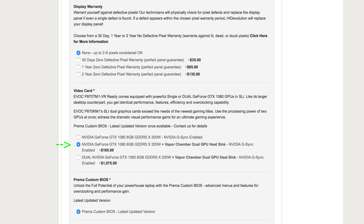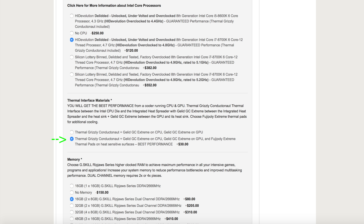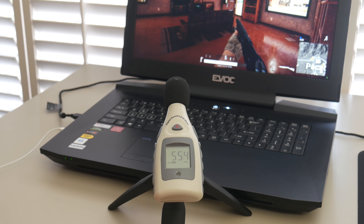Let's take a look at the external temperatures on this laptop. The top section is going to be the hottest at around 47 degrees Celsius. The WASD keys remain pretty cool, coming in at around 37 degrees Celsius, and the bottom right palm rest at 40 degrees Celsius. For the best cooling performance, make sure you upgrade to the vapor chamber dual GPU heatsink and upgrade to the $30 thermal interface materials. With this combination, you'll usually get better cooling performance of up to 12 to 15 degrees Celsius. Overall, I've been highly impressed with the cooling efficiency, especially with desktop-level components inside.